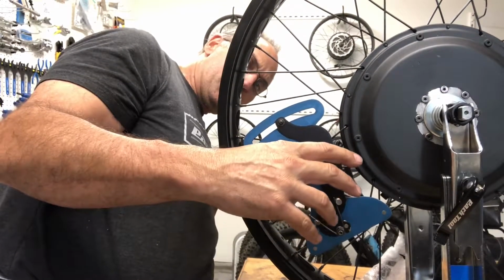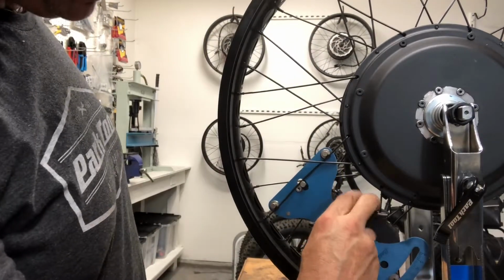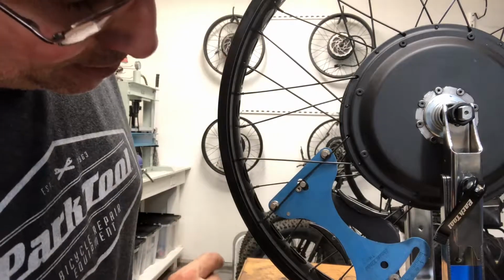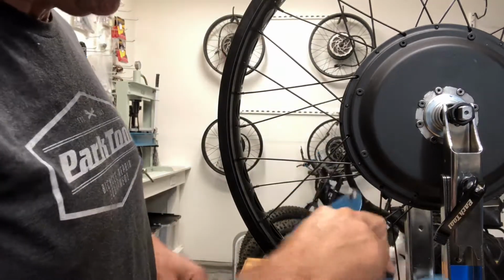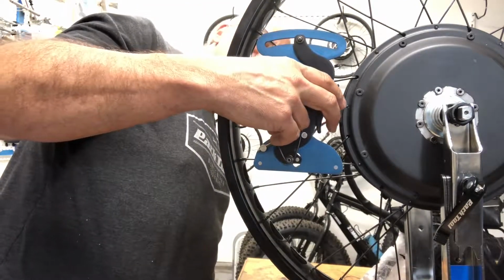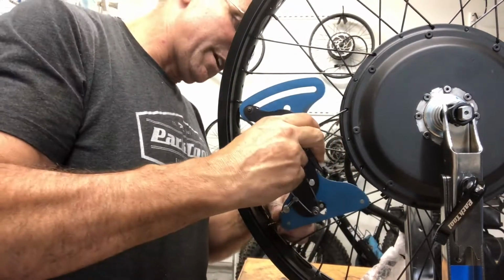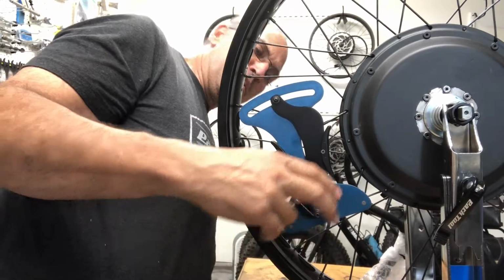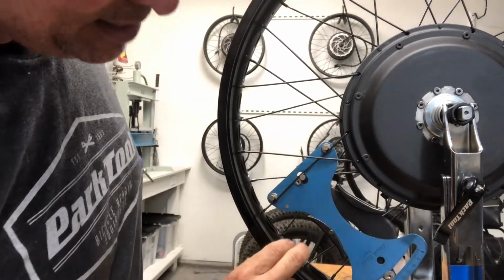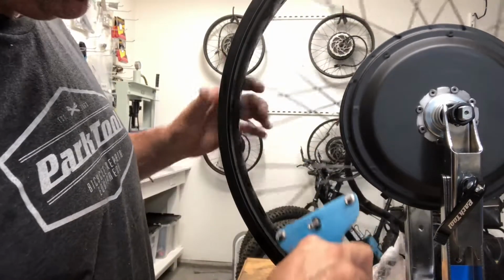I've got 24, and its partner, again, the partner spoke is the spoke that it touches. Its partner is 24.8. 24.8 versus what appears now to be 24.2. That is close enough. So these two here, this is 26.1, and this is 25.7, so that's close enough.